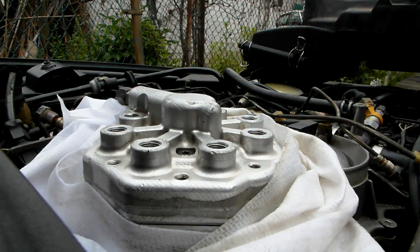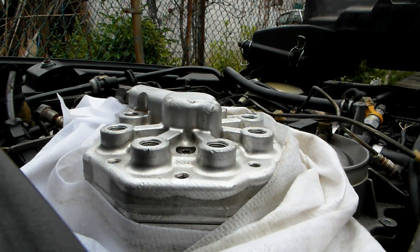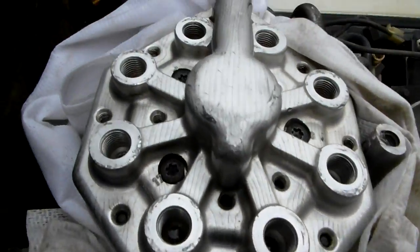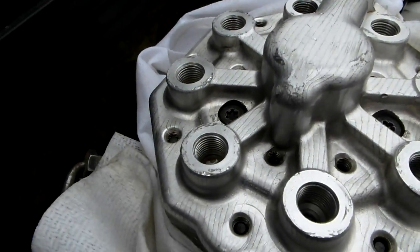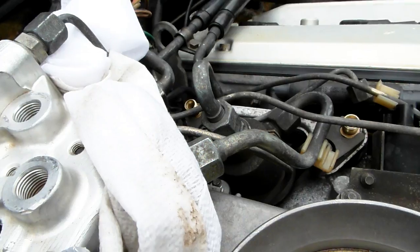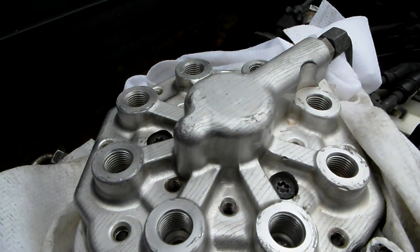The fuel pump is on and I can hear that the fuel is running through. Look at the ports — no fuel is coming out, but you can hear the pump circulating through the fuel pressure regulator. So it does work.